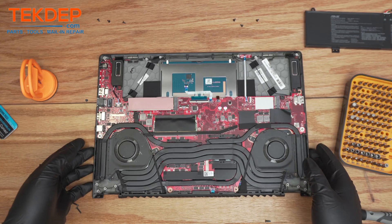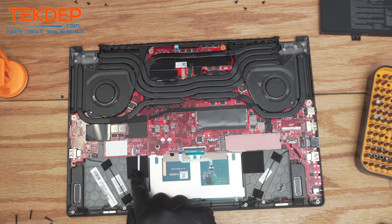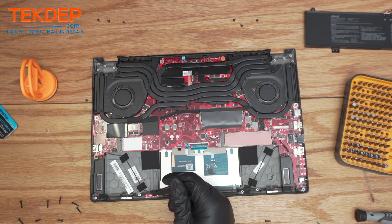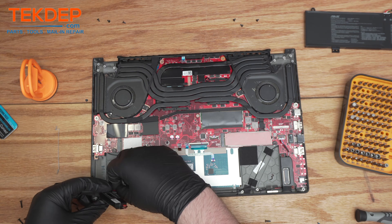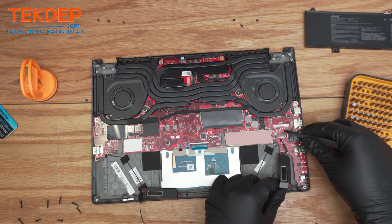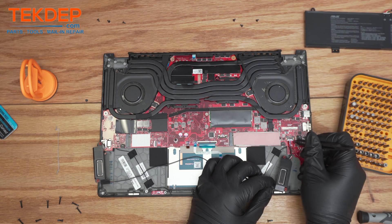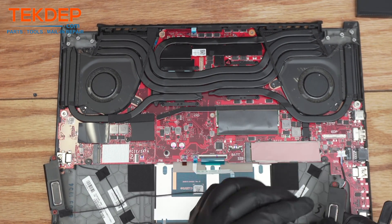At this point, without the battery and screen, you'll notice it's very light. Starting at the bottom by the keyboard and mousepad — pry up and it just slides right out. This side is held in with some adhesive. The speakers come out easy — there are no screws, just these little hooks. Pull it up, and at the end where they're both connected you'll see this little brown bit; the white connector pulls out. It just needs a bit of wiggling — there we go. That's the whole speaker assembly.